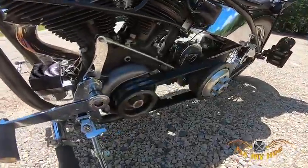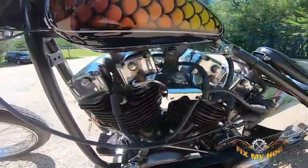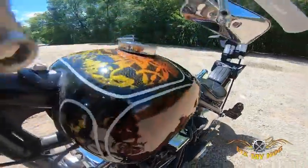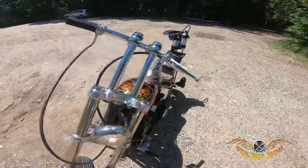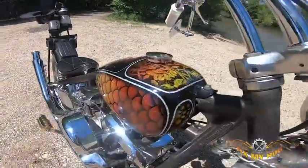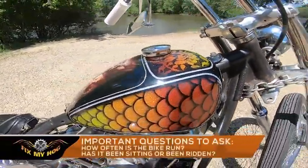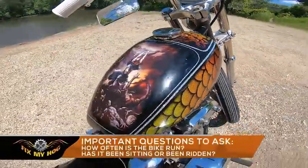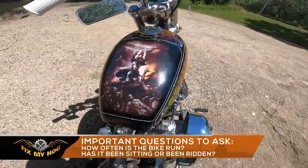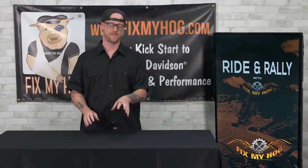Once I figured out I wanted a cone shovel with a ratchet top transmission, I went to a vintage bike dealer that specialized in vintage Harley-Davidsons. I knew it would cost a little more, but I also knew they'd understand what's going on in that motor better than a shade-tree mechanic found on Craigslist or eBay. From there, it's good to ask questions: when was the last time the top end was rebuilt, the carburetor was serviced or rebuilt, the transmission was serviced — these are all big-money items that can definitely affect your buying budget.